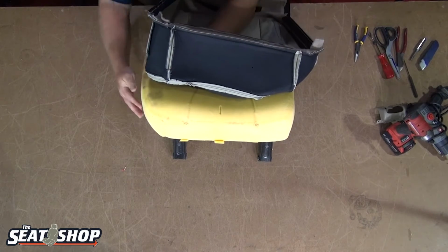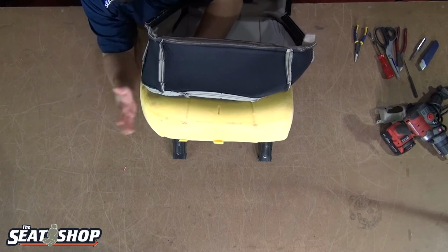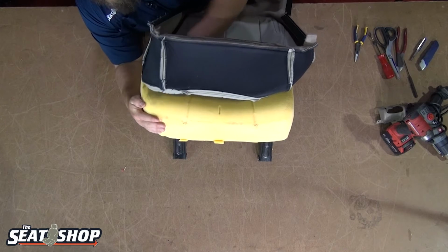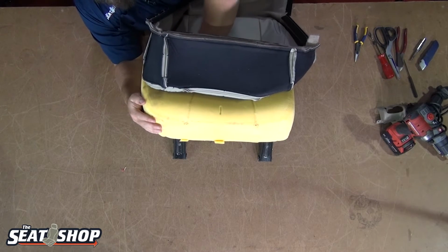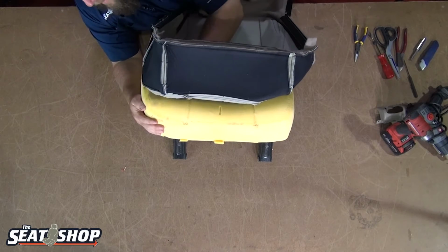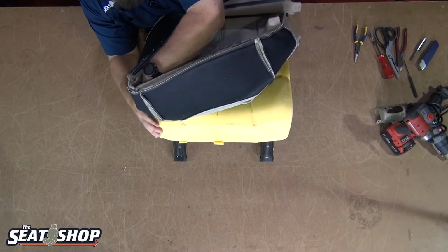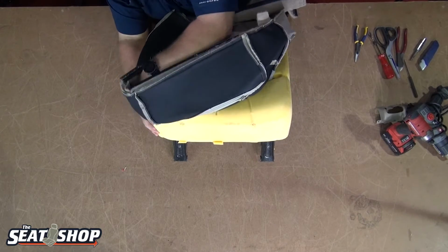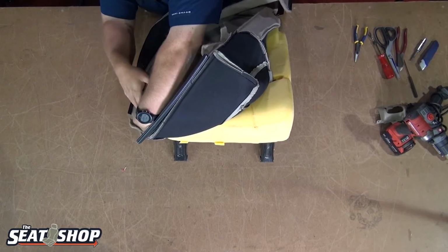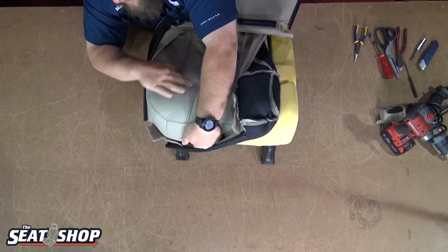Okay. Now I'll start on the corner. Now when I'm wrapping the corner, I'll take my right hand, I'm going to grab the foam, push in and compress the foam, and my other hand my fingers are on the seam line around here. So I'm going to put my fingers on that seam line, keep constant contact, my hands on the cover the entire time, and push in here, and I'm going to be rolling over with this. My left hand is feeding it around, but you want to keep your hand completely on the cover the whole time. There we go. It gives you a nice smooth transition.